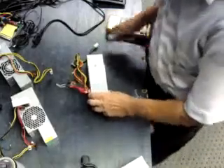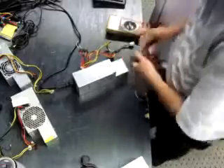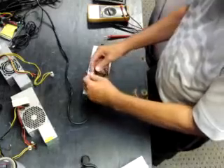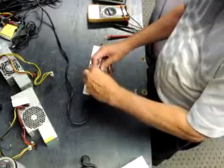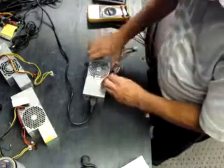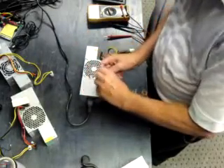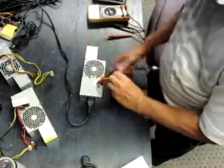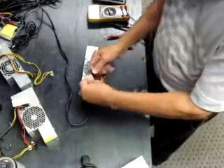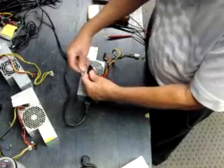We have this power supply that came in on the other batch. I'm going to plug it in and give it some AC. We're going to short out pins three and four. I apply the short wire to that pin and we absolutely don't have anything happening — no fan. Simply a bench test, a way to test them out. It's not working. The power supply is absolutely dead.